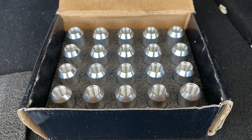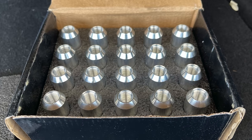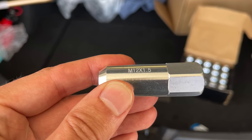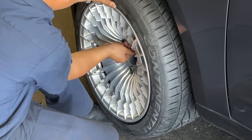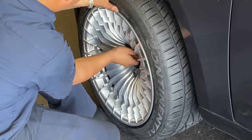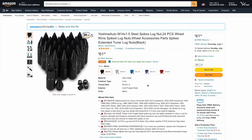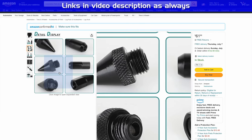And yet another conundrum presents itself. These special bolts that came with the new wheels and allow the hubcaps to bolt onto the wheel are 12mm wide, but the Tesla nuts are 14mm wide and don't allow covers to bolt onto them. So I need some sort of double-ended 14mm ones. So I googled it on Yahoo and I found some 40mm versions on a small web shop called Amazon, and they'll be here tomorrow. Very good service for a small shop.